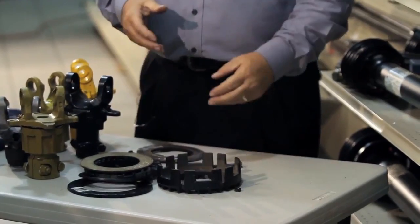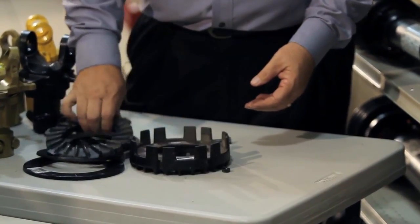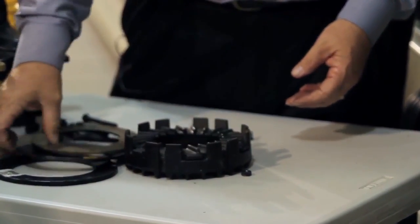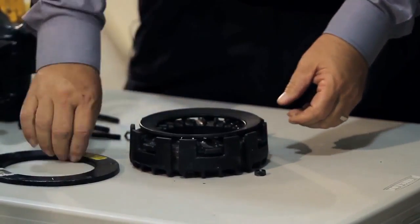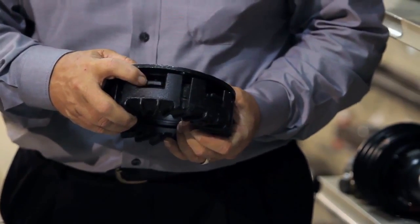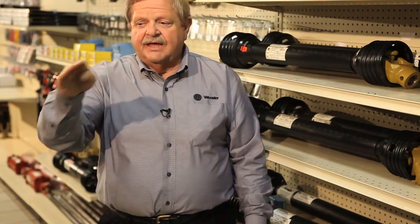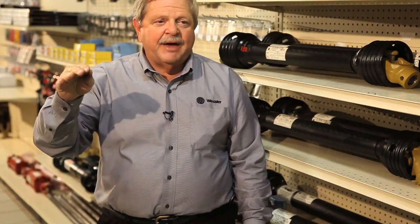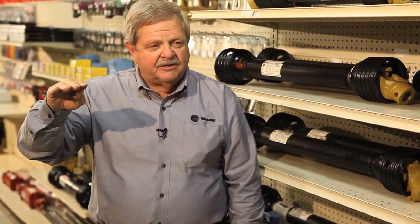What you have is a clutch that lasts about five to seven times longer than any other clutch on the market. As I assemble it back together, you're going to see that you actually have tabs on the side. When this is put together, you have a tab with some distance, and as the clutch wears, this distance decreases — so you can see when you're about out of a clutch. A normal spring clutch has a torque curve that requires periodic tightening, but with this clutch, once you tighten it up, you can't over-tighten it, and it stays consistent until it quits. Then you just replace the friction disc with no damage to the clutch.